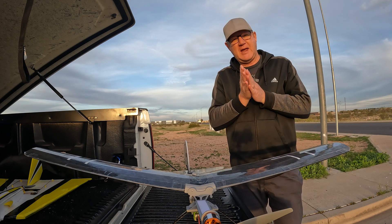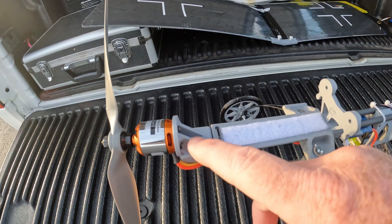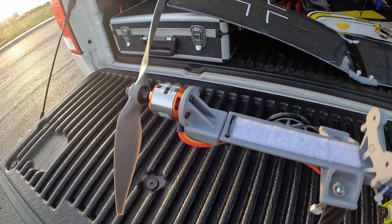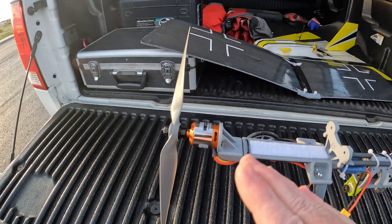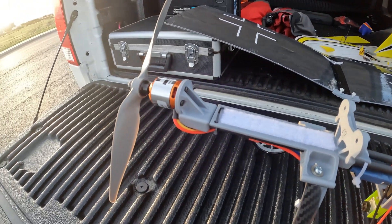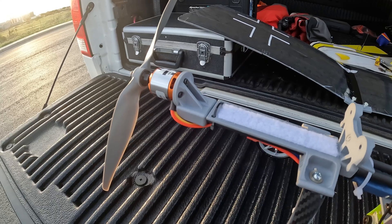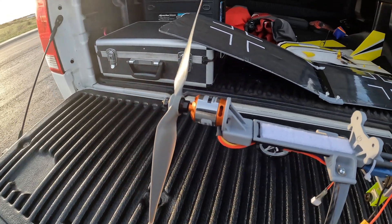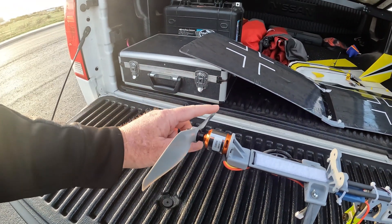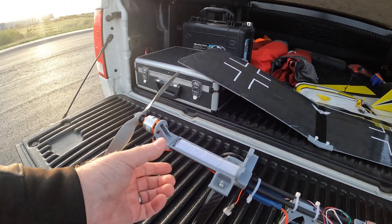Especially if you have the pan servo on the platform. I've also modified and added a couple of different motor mounts with a little bit more bracing. I've given it 3 degrees down and 2 degrees right in the motor mount to help counter the torque rotation of the motor. There is also the standard mount — straight 90 degrees to the shafts. Make sure you're using the correct counterclockwise rotation if you're going to use the offset one, because that's what it's set for.